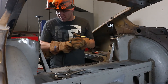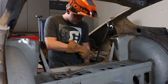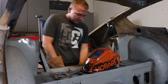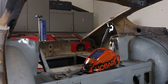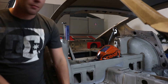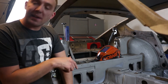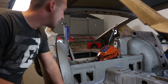I'm out of wire — I'm basically done anyway. We're just going to go through and finish this up. Let's see if I'm actually out of wire or if I'm just crazy. All right, so I got the fuel cell cage welded in. I welded in the patch panels I made to make the floor look normal again, because I'm not going to have a spare tire back there.